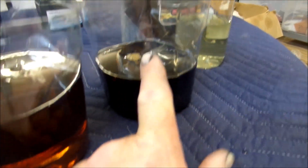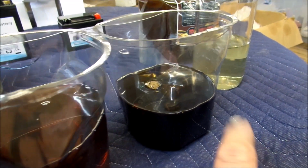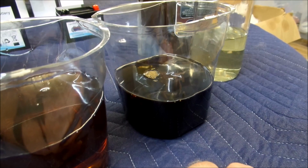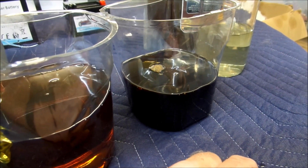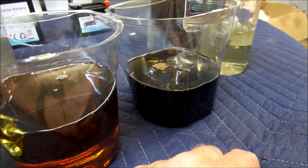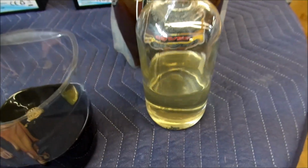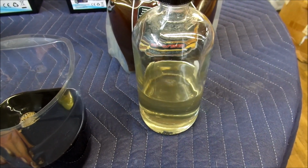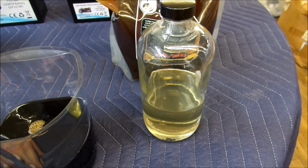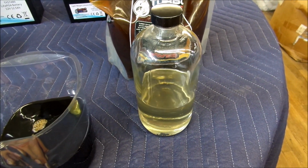This ingredient here is an ingredient that helps the engine to stay clean. It's another form of a detergent. It also is an extreme pressure agent, and once again, it helps it to withstand extremely high temperatures without breaking down. This ingredient right here is used very sparingly, and it is an ingredient that keeps us from having to use so much zinc and phosphor in engine oils to keep it clean.